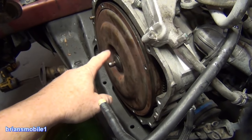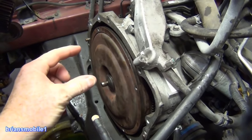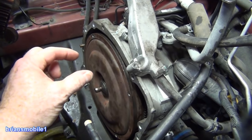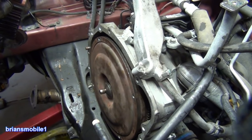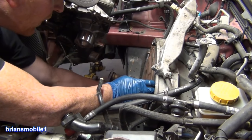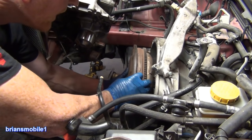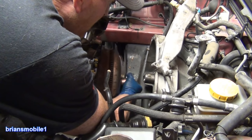You just want to leave it in there. As it turns out, this has a front pump drive that sticks way back in there and slides out. There's a little clip with two tangs, one on each side — you need to rotate it until you locate it, then pinch it and slide it in. Now let's show you from the side how to pull this out. I'll grab through the starter hole and the inspection opening and just slide it right out. There's a C-clip on it.